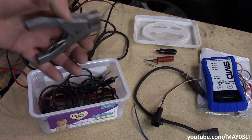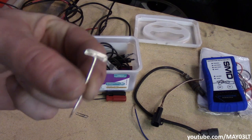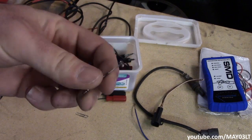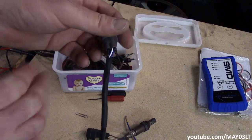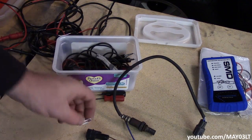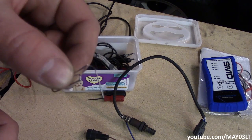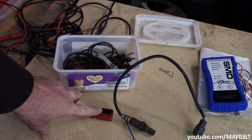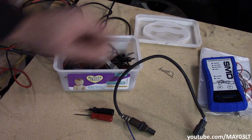This is what they call a T-pin — not really sure why. These things are thin enough that they can back-probe connectors without damaging anything. If you're in a pinch, a metal paper clip will work. I do have a selection of terminal de-pinning tools — not an essential thing, just something I have for taking connectors apart if they need to be repaired or have pins replaced.